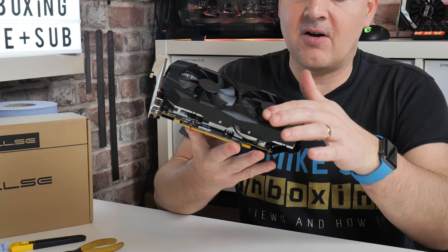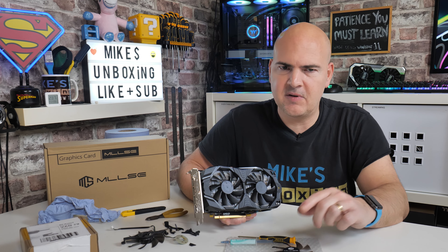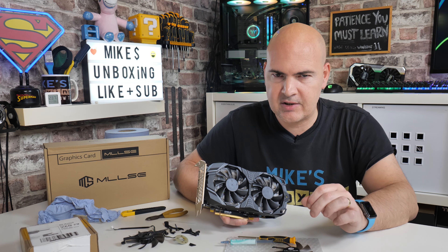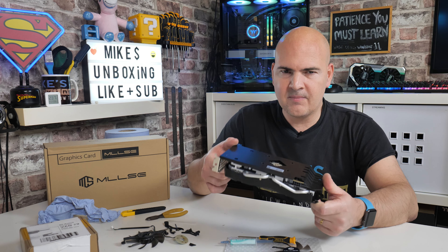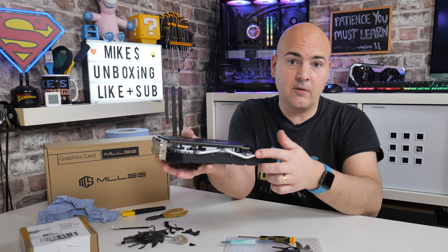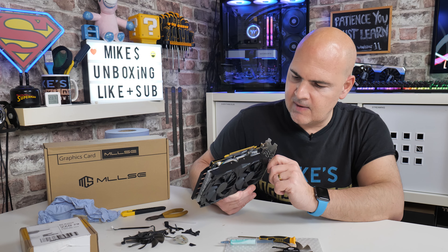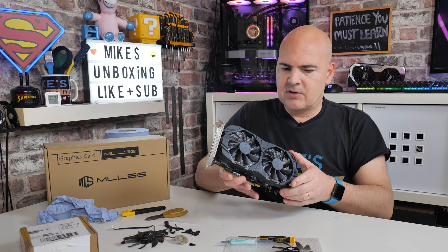The graphics card is now in one piece and ready to be used in our little micro-ITX build. The fans have worked — they're on there, pushed into place, stretched in. It's not perfect but it seems to be working. If there are any knocks or damage they may pop out of those little lugs, but hopefully you shouldn't be doing that to your PC. I've actually rewired it so there's nothing on this side, which makes it look a little neater. On the other side there's a cutout of the plastic, which I may extend a little just to give the cable more flexibility. The top casing fits on perfectly now and the screws have gone in straight and flat.